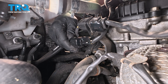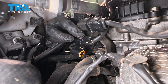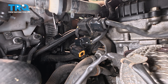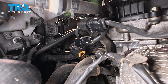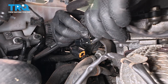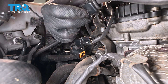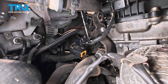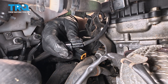To get the connector separate from the bracket, there's a little hole on the top that you need to use a pick on — push down in the center of that hole. You can't really get to it properly without removing the upper O2 sensor, so grab the upper O2 sensor harness on both sides and twist and wiggle it up off the bracket. Now use your pick on the little hole on top, push down, and wiggle the connector off the bracket.